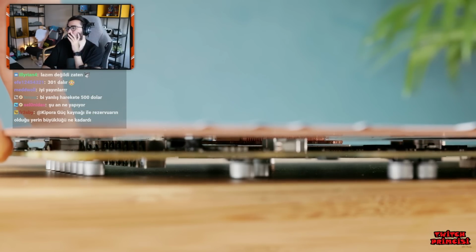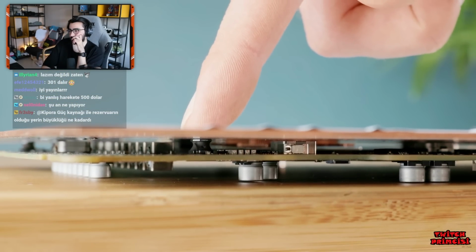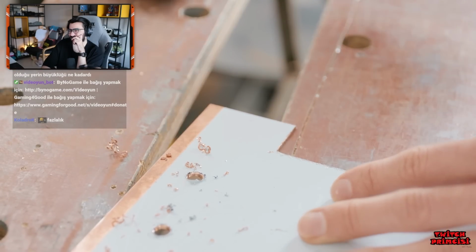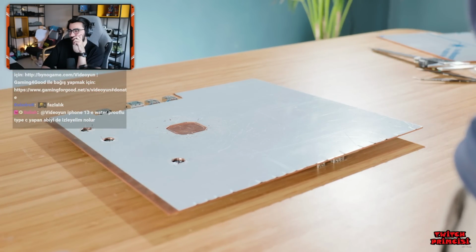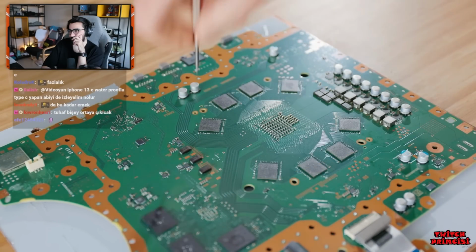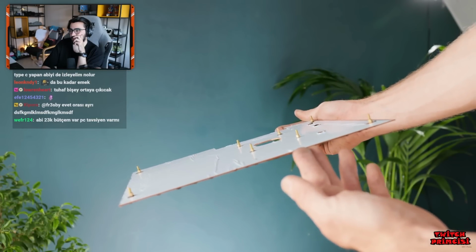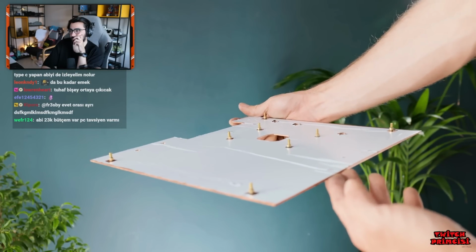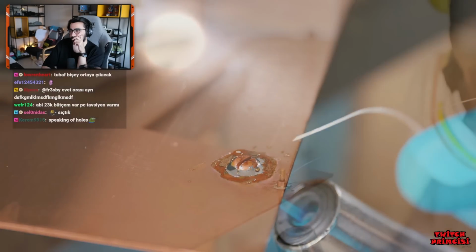There are 3 components that still impact this layer, stopping it from lying flat, but they can be dealt with by drilling a few holes. Speaking of holes, now that this layer does lie flat, it's possible to mark where the motherboard mounting holes are in order to add some brass pillar supports for them. That these are brass is not a coincidence. They need to be made watertight, and to do this I'm going to solder them to the copper itself with a blowtorch.